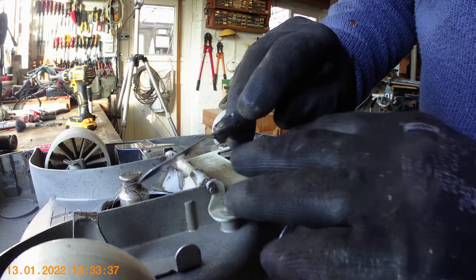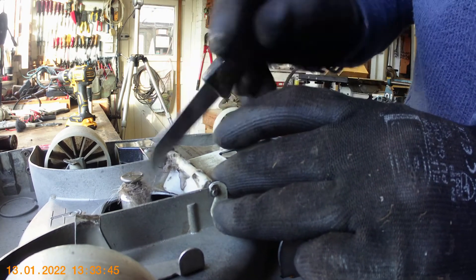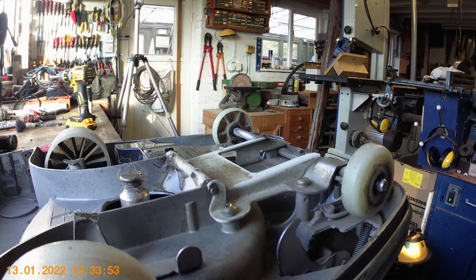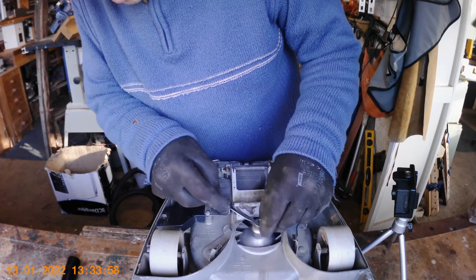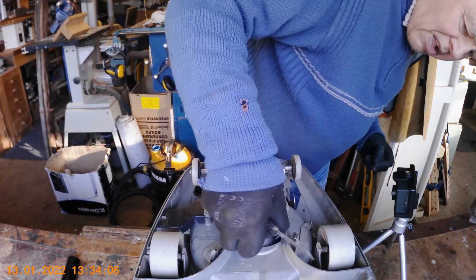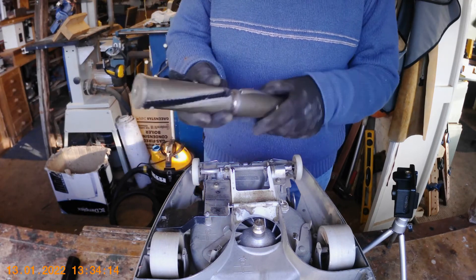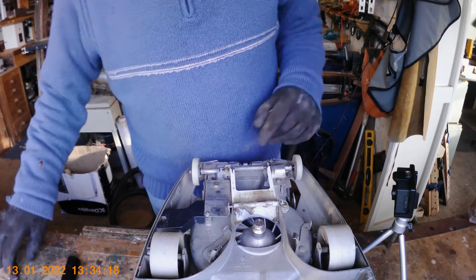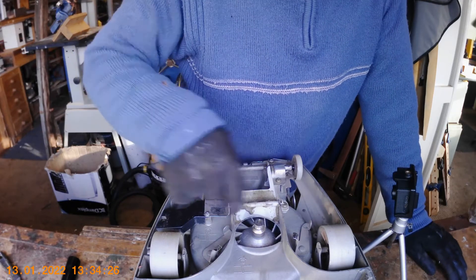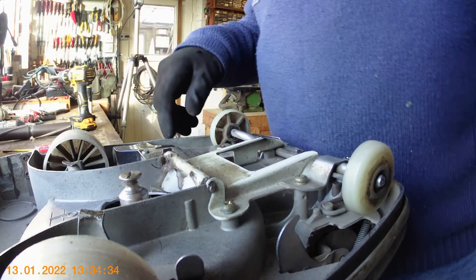Another interesting thing — note around the fan pulley here there's a build-up of hair. If you've got a wife with long hair, it gets in there. We've also got a dog, a German Shepherd called Paddy, though this looks more like human hair to me. Always take that off because the belt won't run properly if you've got a lot of hair on there — it'll tend to make it slip and skid. You get the same thing on the agitator as well; it builds up around there and it does affect drive. Also always check this little converter — if it gets worn or broken it will cause you to lose suction.